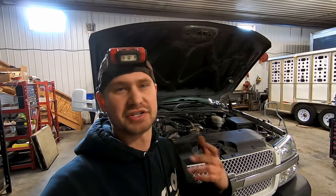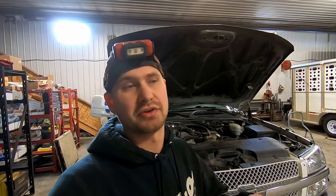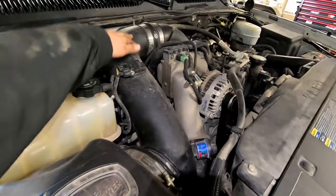I'm going to actually modify the up pipe, so I've got to take the up pipe out, which means I've got to take the factory downpipe out. I've got an aftermarket Flow Pro, part number 1010 — this is going to have much better airflow than the factory downpipe. We're going to start by removing the EGR cooler. Once we have it out, I'll show you where to put the blocker plates, and then we'll remove the downpipe and up pipe.